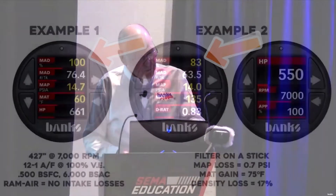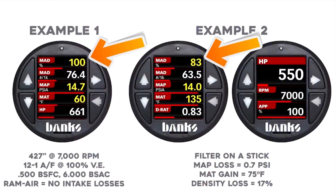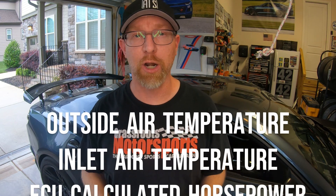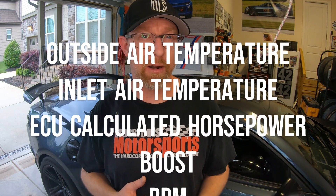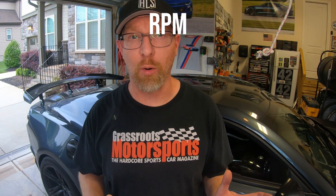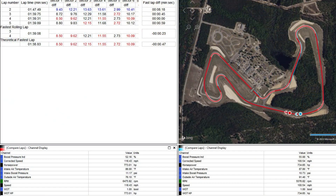Your density went from 100% to 83% — that's kind of criminal. We're using the Chevrolet Performance Data Recorder, or PDR, which is a factory option with the Camaros, to capture lap data which includes some OBD2 data. We're going to be capturing outside air temp, ambient air temp, calculated horsepower, boost, and RPM. Then we're going to use Cosworth Pi Toolbox, which is a free software package that allows us to get into that data.